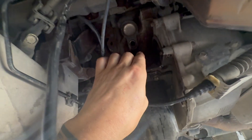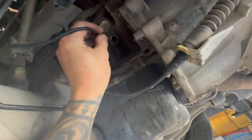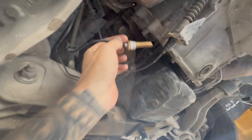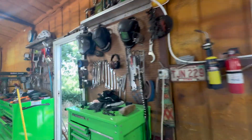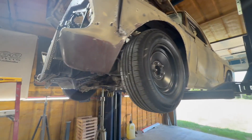Under this freeze plug is an Allen head - I pulled it out and I'm going to put the temp sensor in there. I think that would actually be better because that's going to give me block heat. If I'm not mistaken, that would be pre-thermostat, so it's a true temp reading.